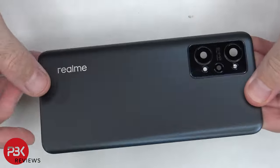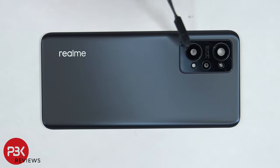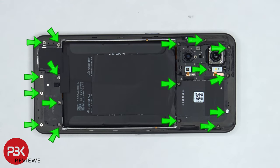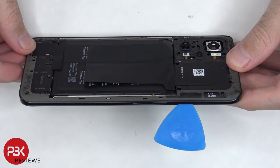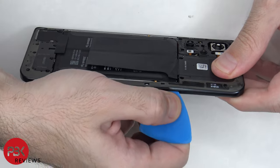Here's a better look at the glass back plate. The glass camera lens cover can be replaced by applying heat and prying it off. Here's a look at the other side. There are 17 Phillips screws which need to be removed. Once all the screws are removed, we're going to place the plastic pry tool in between the back housing and the frame of the screen, and then run along the edges to pop off the back plate.